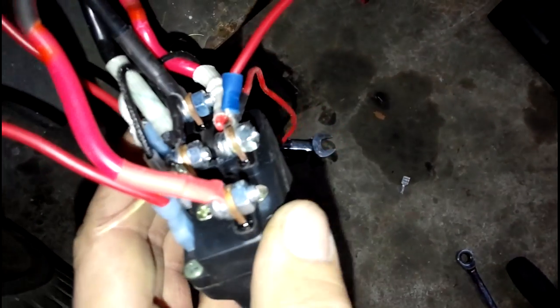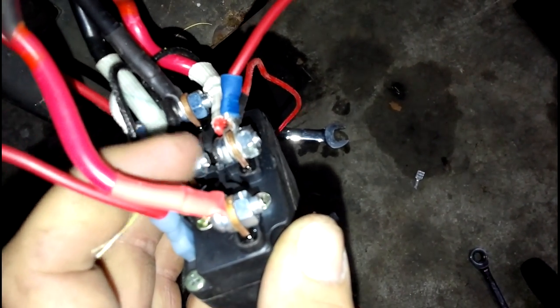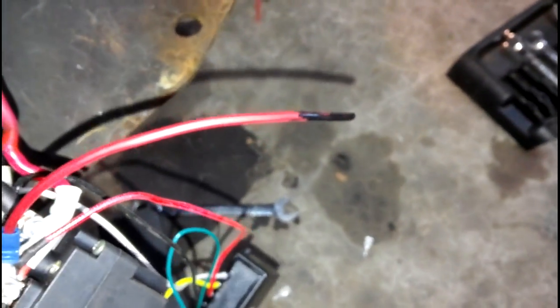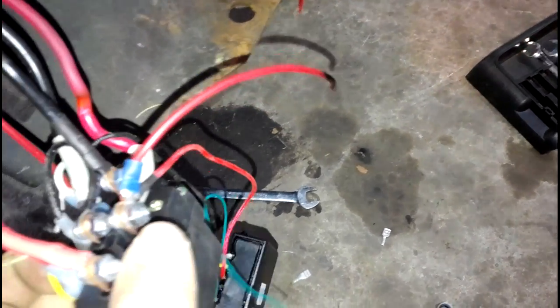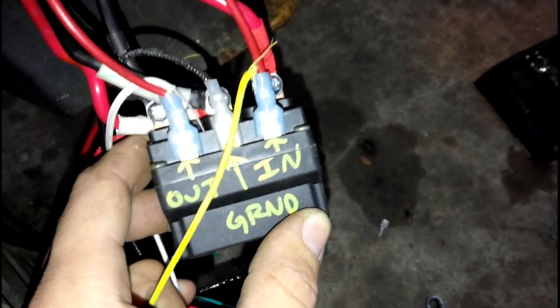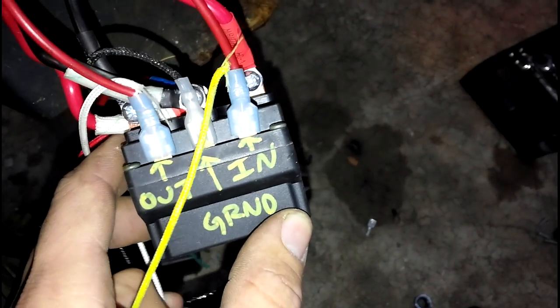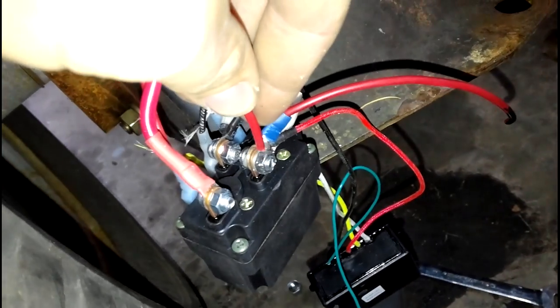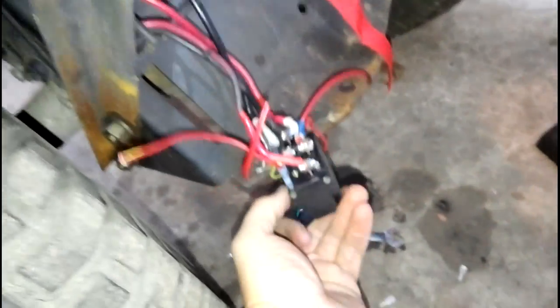I'm going to get my connectors and wire all this stuff up and show you what it'll look like once you're done. Here it is all wired up — this screw down here is a little tricky to get to. Make sure that you disconnect the battery before doing this, because if those screws make contact, they're going to try to weld themselves together. I have color-coded it and painted the ends so you don't mix it up later. The far right or yellow one is the in part, the white is the out control, and the center is ground — you don't need to worry about that.